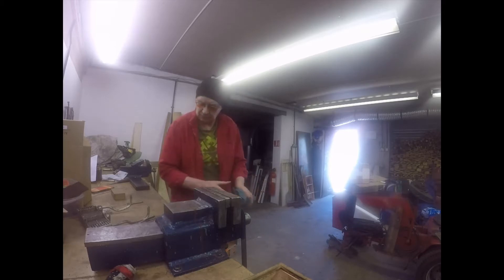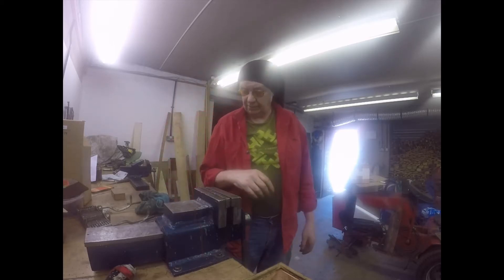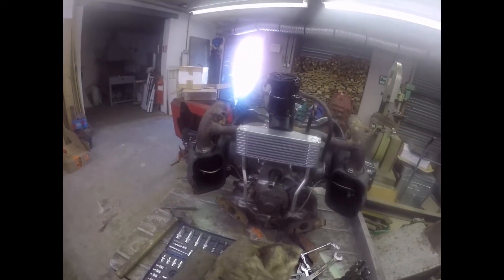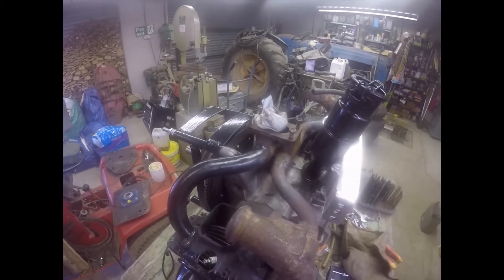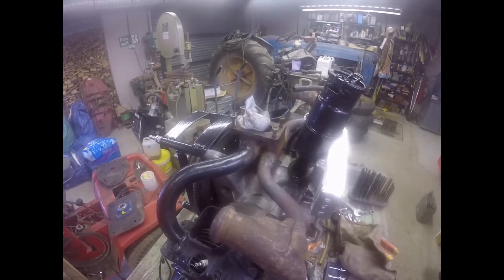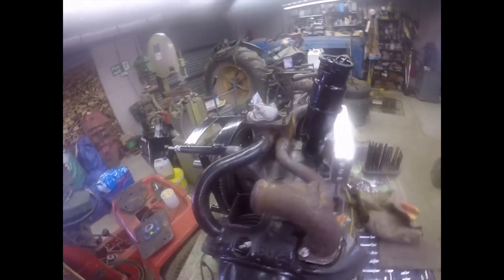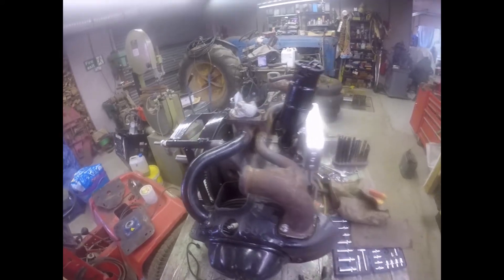I've checked up on the oil feed pipe and I've fitted the new oil cooler — all copper slipped and bolted on with plenty of clearance down there. So that job's done. Next job is to rebuild the carburetor and rebuild the alternator which has dry bearings. I'm going to crack on with those and I'll bring you back and show you some of each.